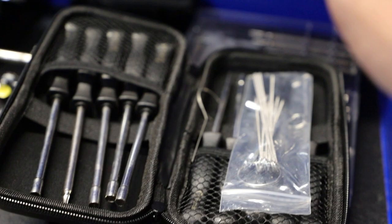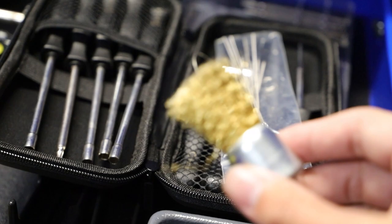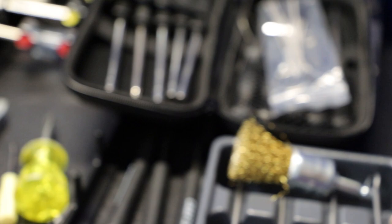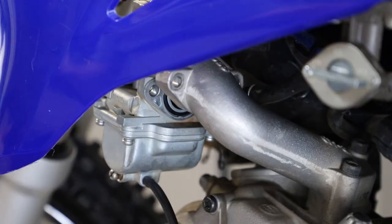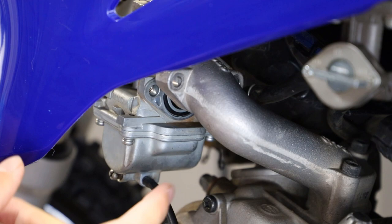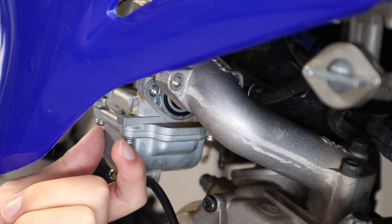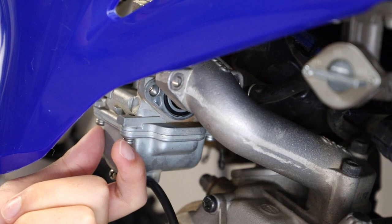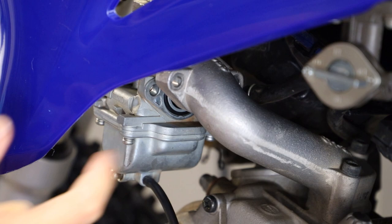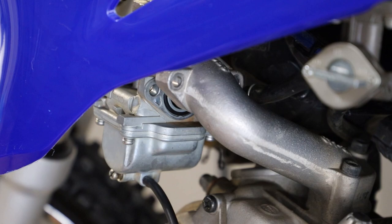If you do have the little carburetor cleaning tools, those work way better, but in a pinch the wire brush method works. That's really only if you have some really lodged-in debris — most of the time carburetor cleaner will do just fine. So here I have the float bowl back on. For installing the jets, just put them in hand-tight and snug them down — you really don't want a lot of torque on the jets because they're made of brass and strip very easily. Same thing with the float bowl screws: you really don't need much torque at all. Just nice and snug, that's it.